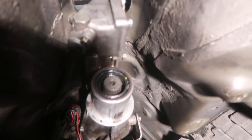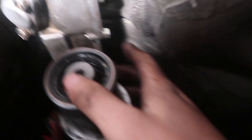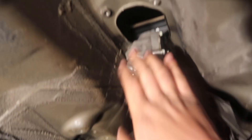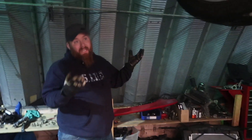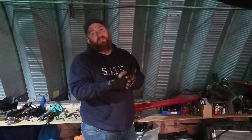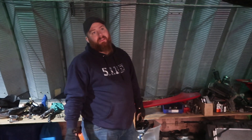Here's a pro tip if you guys are going to be doing this specifically in a JC Cosmo: you're going to want to modify your trans hole. You're going to want to cut out probably an inch or two forward and then cut across — basically extend the hole out an inch forward. If you do that, you can learn from our mistake and literally just bolt the trans in without even pushing your engine up in the front. The trans will go in and you'll have enough space so it can go where it needs to go.